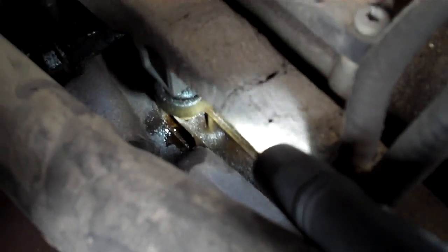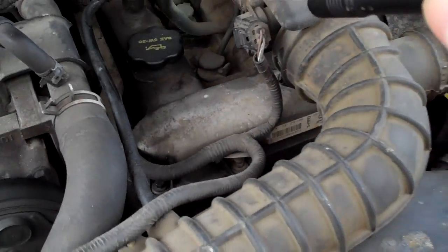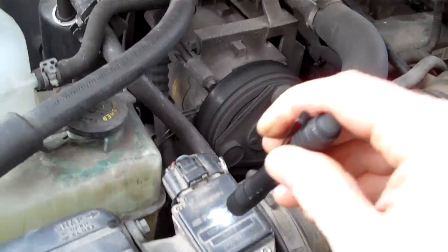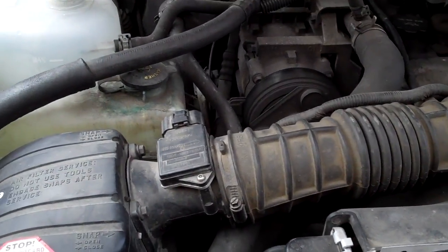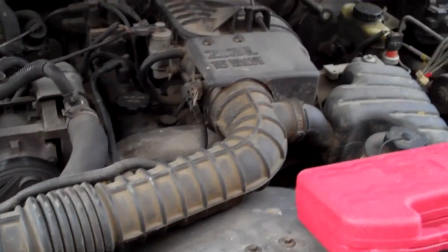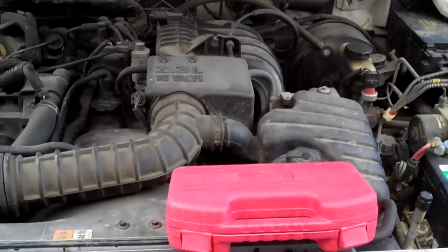The other thing he does need — if you look back under here, you can see how it's all wet — he desperately needs a valve cover gasket. This is your valve cover here where you see the bolts. He probably also needs a tune-up since it's running rough, and I'm willing to bet his mass air flow sensor is contaminated and needs to be cleaned or replaced. To do all that, fix the hose, and everything else, I'm going to say it's going to be well under $500.